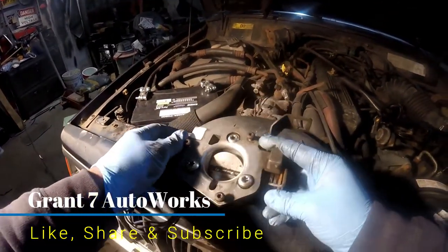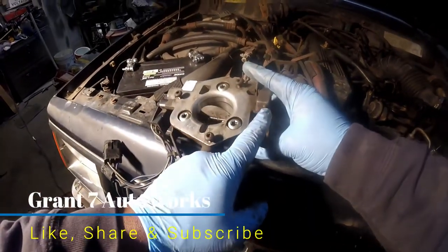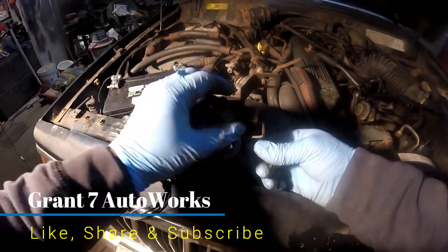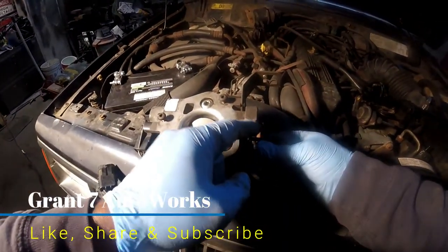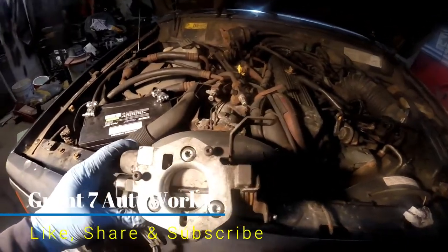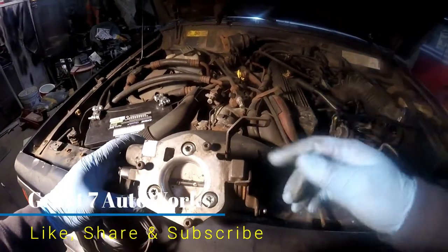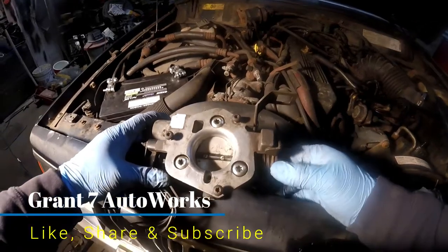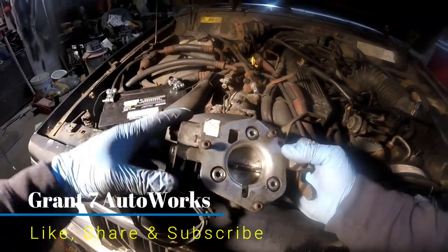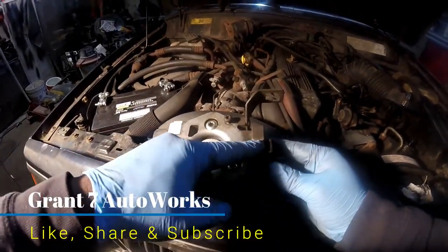On mine, I couldn't turn this. So what I ended up doing, I took a grinder and shaved it down little by little. Don't go too far - you don't want it to close all the way because it's going to cut off. Just shave it off just a little bit and this will keep closing just a little bit more. This Jeep was revving up to about 3,000 RPM just as soon as I started it. Everything I did would bring it down to about 1,100, but I still thought that was a little high. So this is what I did to get it where I want.